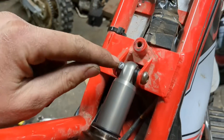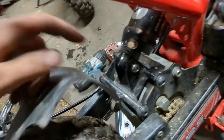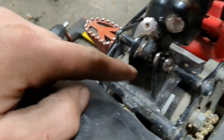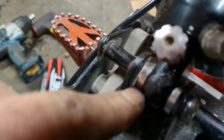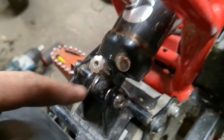I had to fabricate a little bushing and drill it out for the original hole size. For this end, all I had to do was drill it out and make a tiny little spacer — I think it was about 20 gauge steel — basically a small spacer to space it out correctly.